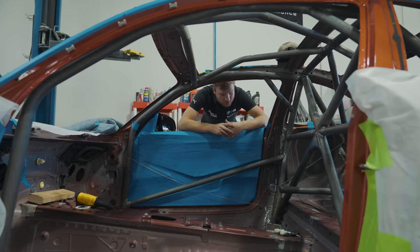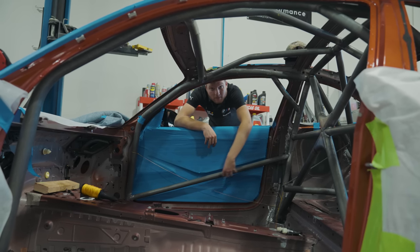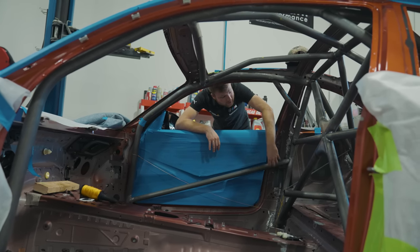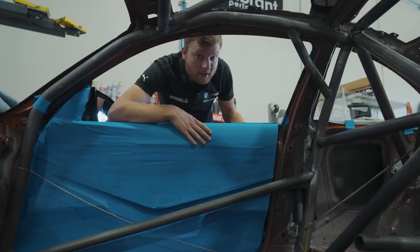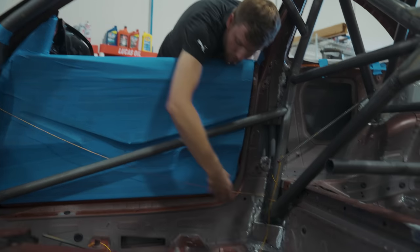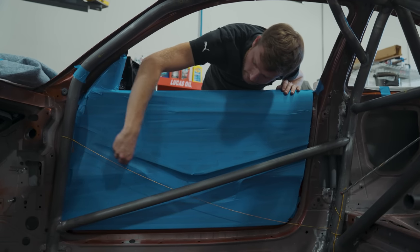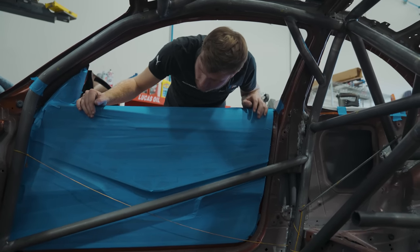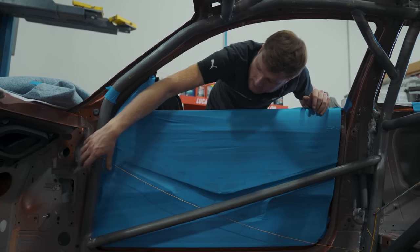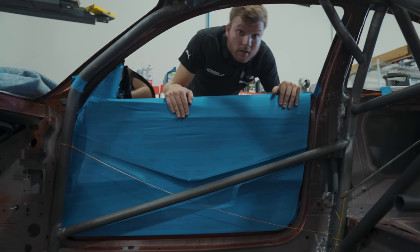We're into one of the hardest parts of this cage install right now. We've got carbon door cards with inlays for these door bars, so it's quite important that we follow that curvature — otherwise it's going to look rubbish — and that's really hard to do. However, we've managed to get the first bar in and it's looking really nice. When the door shuts, that bar follows the inlay line all the way down, and the subsequent bars will do the same. These bars are designed for the BMW Motorsport car these door cards came from, so they sit quite high up — which is for maximum safety.